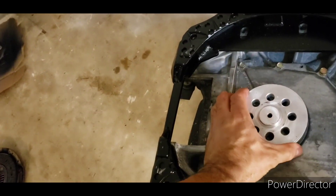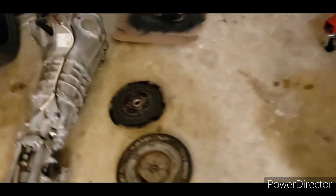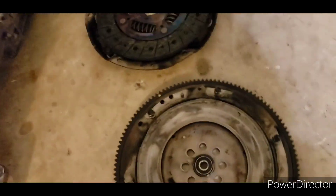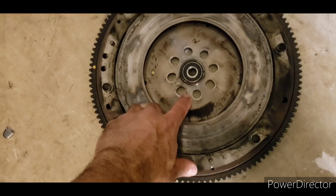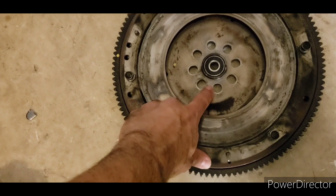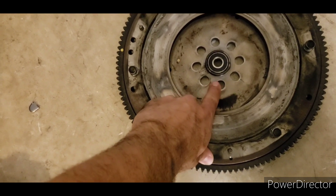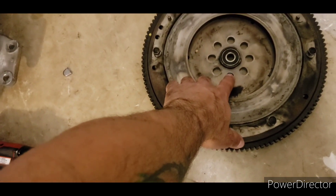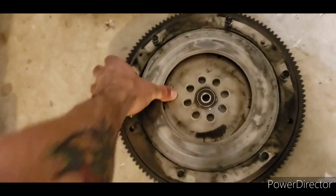The spacer goes in here like so — it gives me the space that I need. On the flywheel I did it by hand on this one because I'm going to go with an aluminum one. The bolt pattern is almost identical to the Honda — you just have to make the hole a little bigger, a little inward. If you have access to a machine shop it'll be really easy to just open that up.